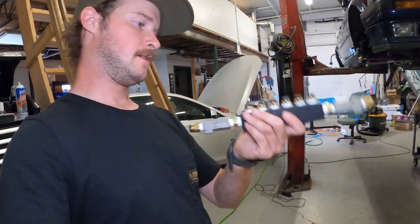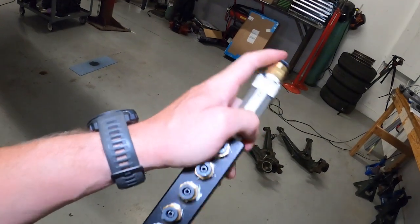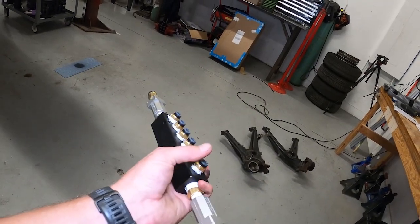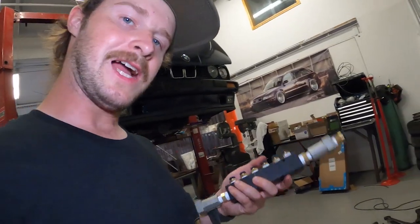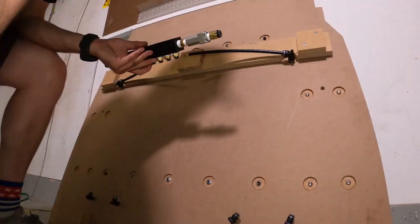Basically, we've got all the straights and the check valves. The compressor is going to go in each end, here goes into the tank, and then all those tanks also feed into this manifold and go out to the 3-port manifold. I'm going to fashion a way to fasten this. Not worried about the tape hanging out — it is what it is. It's a much more reliable seal, even though we did pressure test that and deemed it adequate. This will just last longer over time and makes it a little less messy.